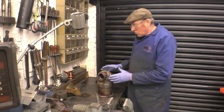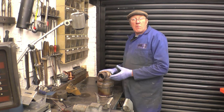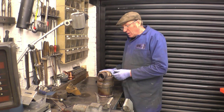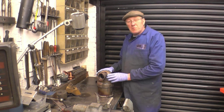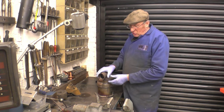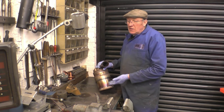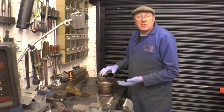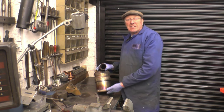Any particles of soot are caught on top of that matrix. As the exhaust heats up, the soot starts to burn. Most of it burns away and you're left with a small amount of ash. If the exhaust doesn't get hot enough, this starts to become blocked up. There are a couple of sensors — one before and one after — giving you a differential pressure sensor.